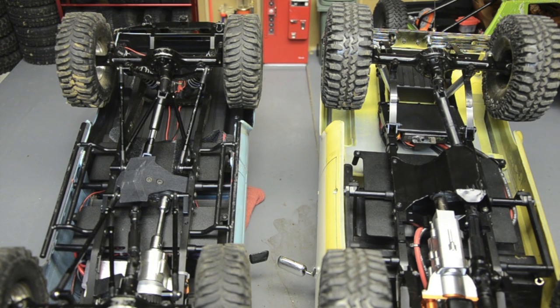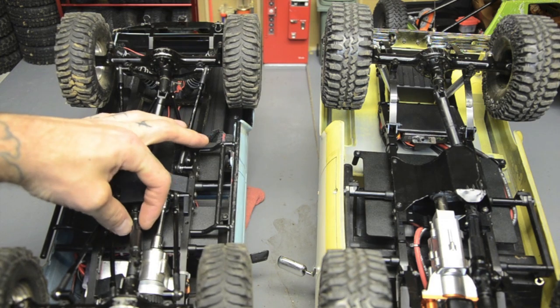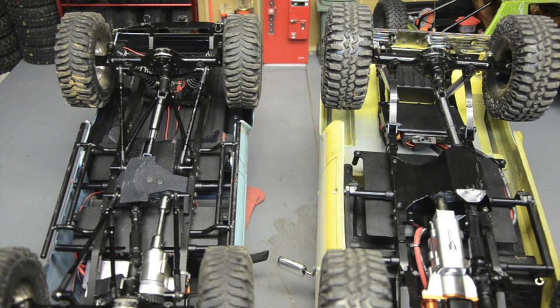It works. It hasn't popped off, hasn't broke, nothing's happened. I've driven it. It works, but that bugs me, just having that much wiggle in it. Not sure if you can even see that. That's at the weight of the axle and tire setting on it. So I thought, okay, since the transfer case is moved, I'm going to need longer shafts.